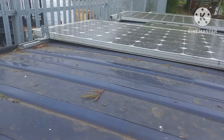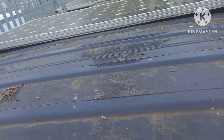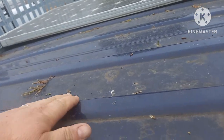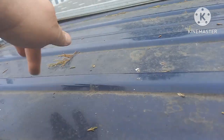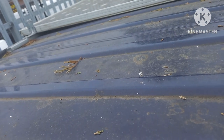First job is to make sure we've got from that solar panel backwards 400mm, which we have. I've got these ribs to contend with — once I've cut through them I have to build up the tape in between here and around the edges, and then the Sikaflex.